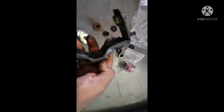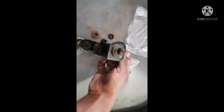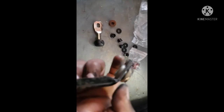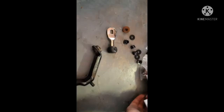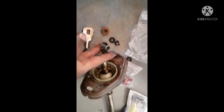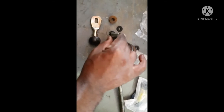I've got this bracket here — this is the bracket that I showed you guys. This mounts onto your steering rack. And the lollipop actually fits underneath there like that. So as you guys can see, this has bushings in here. These see-through bushings here — you just take a screwdriver, pop it out and put the new bushing in. That's two of the bushings. And then underneath here, this is where your shaft actually has got a fork that fits in there. Then you've got these little bushings here that fit there to prevent play on your shaft.